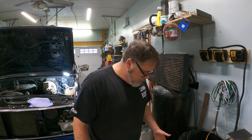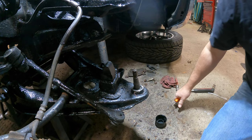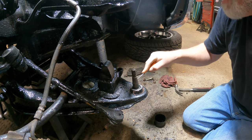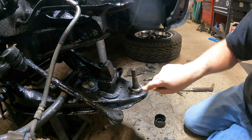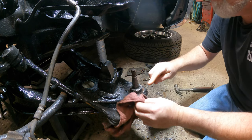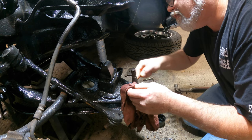Anybody that has an S10 - I have all these parts. Steve, do you need S10 parts? Leave a comment down below. While we're down here, we might as well dig this out. I'm pretty sure there might be a pressure ring in here that we have to get out, so we better check that, because we're about to pound on this ball joint. If there's a ring on her... but I'm pretty sure these are just pressed in. I think the S10s are the ones that are ringed. I can't remember these ones. No, there's nothing there, Jim.